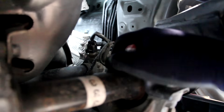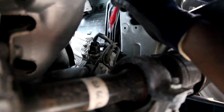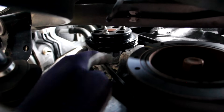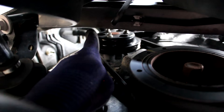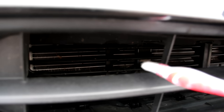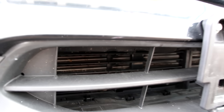Looking from underneath we've got the passenger CV axle and just above that we've got the water pump, which has a bypass hose that takes coolant over to the junction box. We've also got a coolant temperature sensor over here. The water pump and crank pulley are down here. There is no tensioner on this belt, which means the manual actually suggests that you stuff a rag underneath here, turn the crank pulley, and that cloth is going to allow this belt to peel off and peel on. To further aid with aerodynamics and cooling, the lower half grille on the CX-5 has an active grille shutter — these flaps are going to open and close with an electronic motor depending on the cooling requirement of the vehicle.